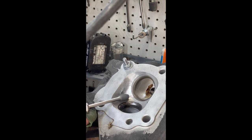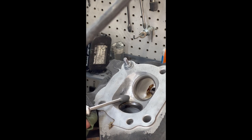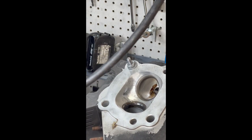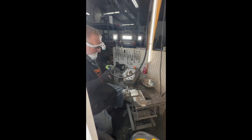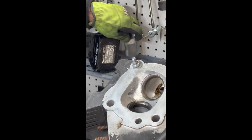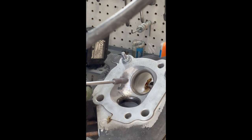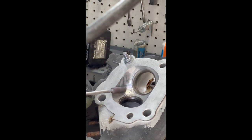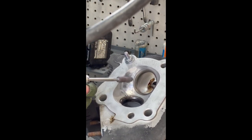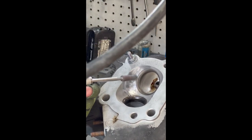I just wanted you to see how we get that textured finish on the port. And then on the sanding roll — sometimes I'll take a contact cleaner to clean the sanding roll — but you can just come in here and see the nice finish you can get. The ports really look neat on the exhaust ports when you do this. And believe it or not, one of these sanding rolls will last you for three sets of heads. See how nice the finish is on there?